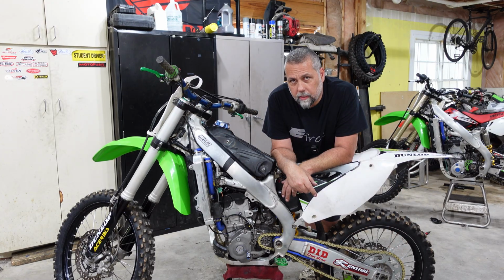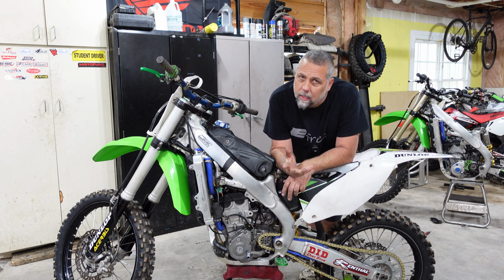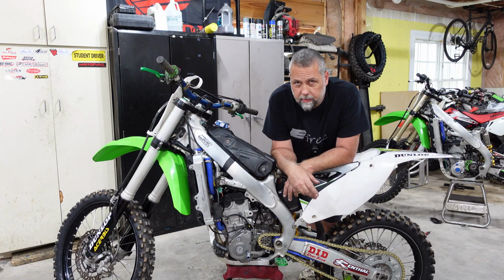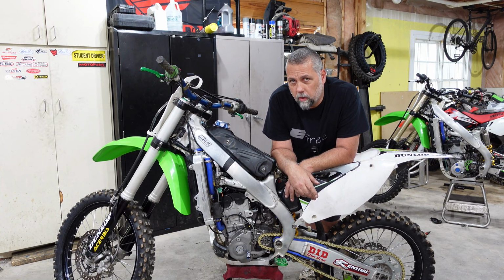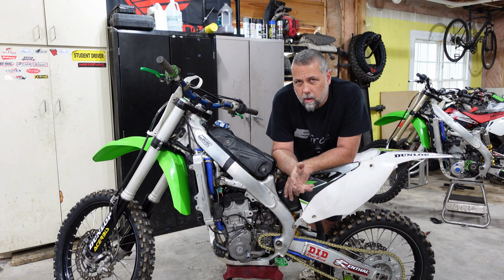So I'll tell you, this is going to be a lesson learned for me. I'm going to check that crankshaft keyway first thing whenever we got an issue from now on. So definitely learned something here. The other sensors were showing out of spec. They definitely needed adjustment. Some of them needed replacement. They just, however, were not the problem. And they probably weren't off enough to cause any kind of major issues.